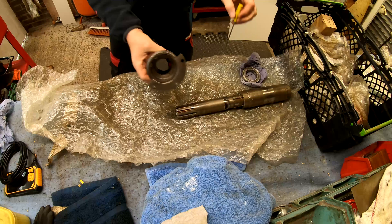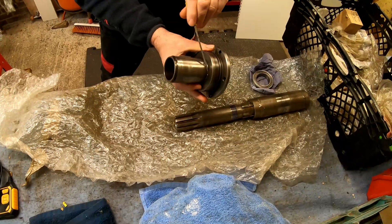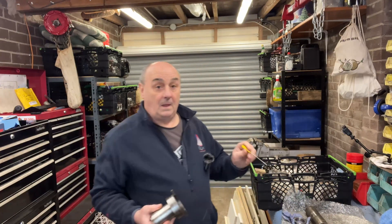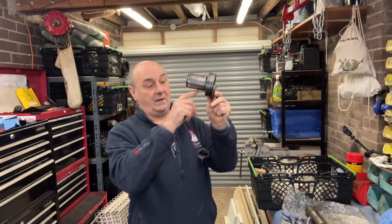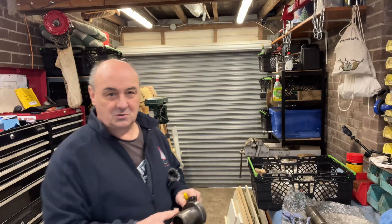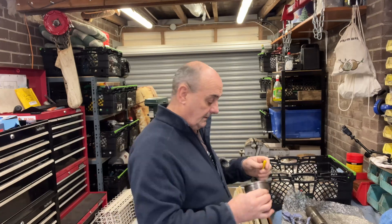The shaft fits through it. Down inside here there is a drain hole, and that drain hole comes forward out of here into the bell housing. What I'm going to do in a minute is put the endoscope up inside the bell housing and have a look to see if there's any oil — any traces of oil — leaking out past that tiny little hole. Could that be the source of our oil leak? Or is it indeed leaking at the crankcase seal, which is a rope seal? And I've never liked rope seals. They are very effective when they're working properly, but...